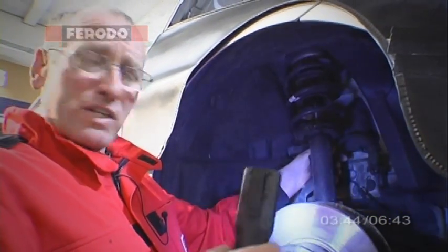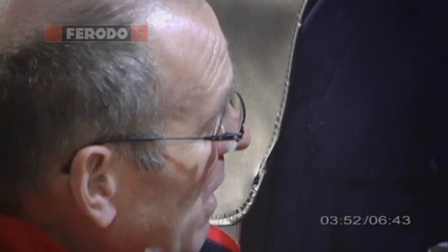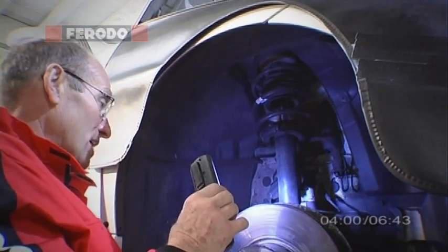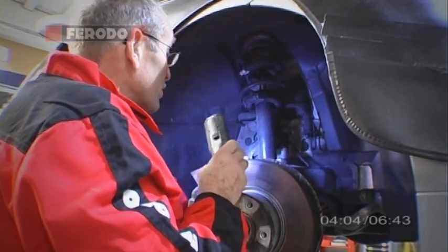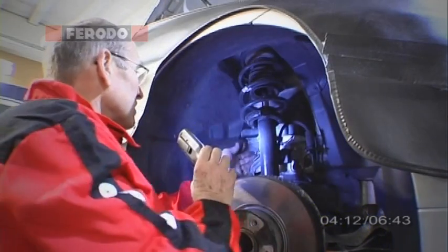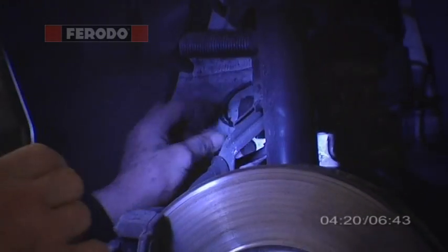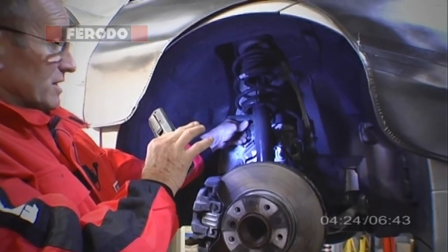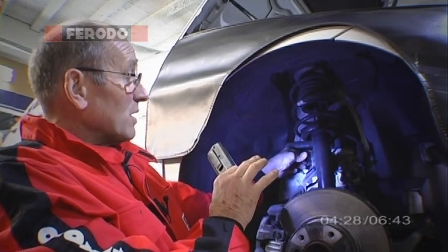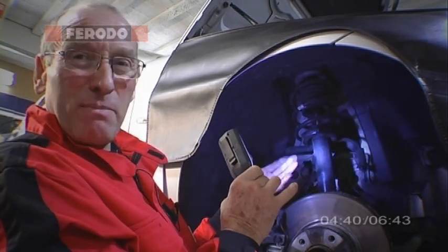Quite often, if the vehicle's been involved in accident damage, the evidence is often here to be seen. You look at the facets, the wheel linings, the suspension, look for bolts — are there signs of witness marks of recent work? It looks original; I can't see any recent work. I have no reason to suspect this has had any major damage or replacement. The hoses look quite good. I'm checking the bushing, the clipping, the electrical connections — both to the ABS, they're clipped properly, the cable appears to be in good condition. Brake level sensor wiring — BMW uses this small conduit here to actually contain the sockets. Regrettably, though, it doesn't restrict moisture, dirt and ingress, as you can see. So one of the issues here is, take a look inside these — if there are any issues with ABS sensor input, brake warning pad level, sensor errors, that's the first place to go and take a look. It's a bit of common sense here, really.